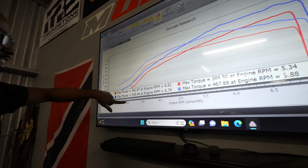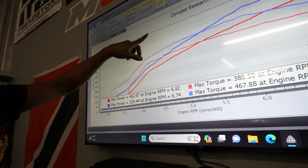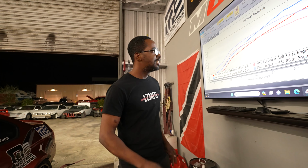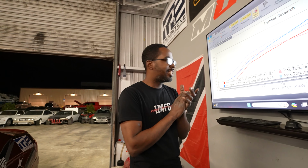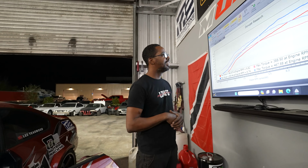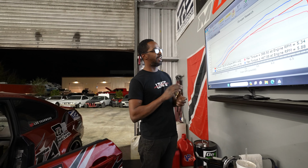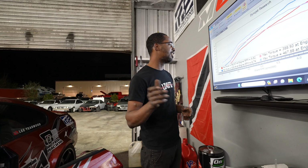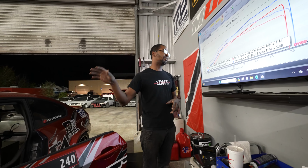I'm also hitting the car after 35 and it spools up really fast. So far, by the dyno numbers, 3.2 is the choice, which we knew because the 34 has this. I'm gonna let it cool down, check over some stuff, and then we'll do a full pull and start adding boost. I'm not looking for nothing crazy, probably back to where we was, 549. This is the motor that we're going to use in the FD car, so I don't want to go crazy with turning it up now.